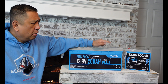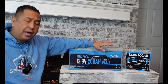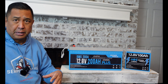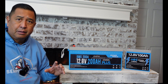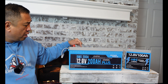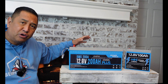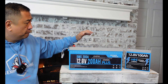I'm building a Ram ProMaster as another option for me to go camping or traveling. Having only a 100 amp hour battery for that, I would have to use multiple batteries and wire them in either series or parallel. The other option is to get a larger battery, and this one right here is a 12.8 200 amp hour — we're talking about 2,560 watt hours of battery power.